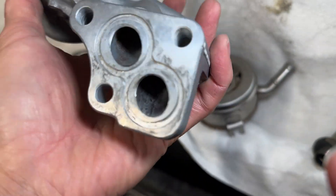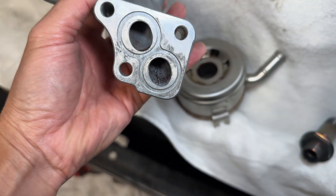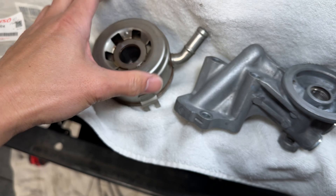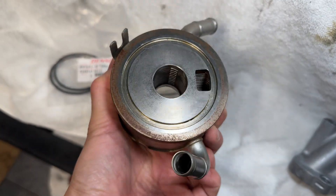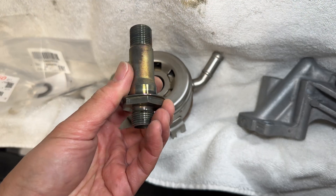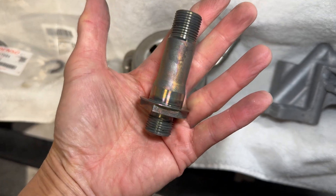On these mating surfaces right here, since this is a mating surface, I'm gonna hit it up with a scotch-brite just to clean that up a little bit before we put it on to the block, so that corrosion and oxidation don't spread over time. The front side looks good. We're gonna go ahead and put the seals in. I let this thing dry for a bit and heated it up with a heat gun to make sure everything was dry on the inside. The center area that we saw earlier is spotless now — everything's cleaned inside and out.